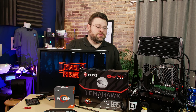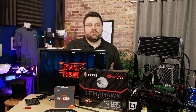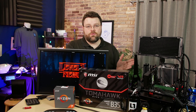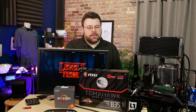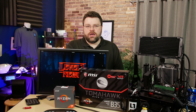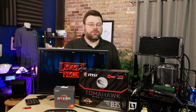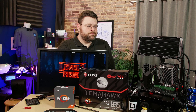If you're looking to build an inexpensive system, B350 boards like this are really, really affordable. If this board worked a little better in Linux, it's something I would use with the Ryzen 1700. The Ryzen 1700 is a tremendous value and this board is really inexpensive for what you get — B350 plus 1700 is a pretty good combination. I'm a little disappointed that ECC memory doesn't work, but that could be a software problem and we could see a UEFI update in the future that enables ECC functionality. I also want to revisit this board after the UEFI matures and after APUs come out — if you can get a four-core APU with good performance, this might make a good Linux system as well.